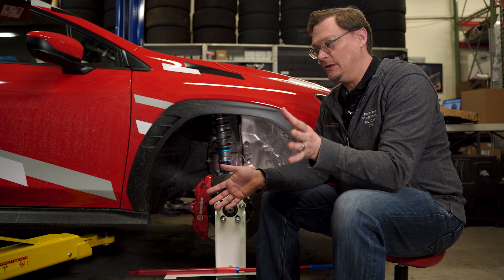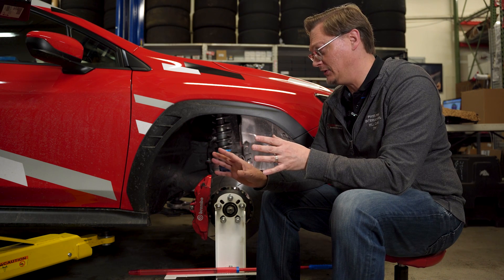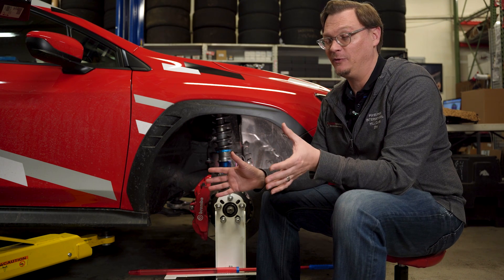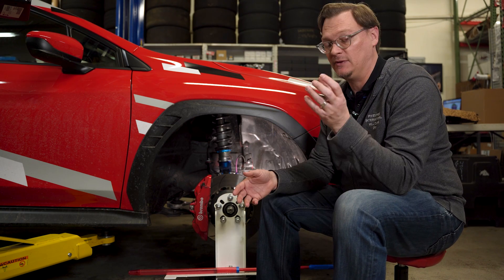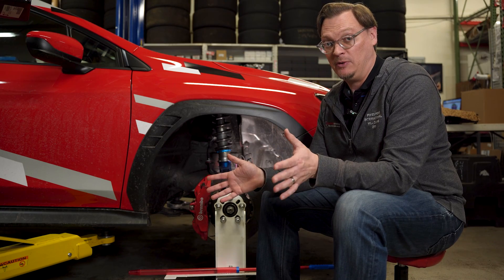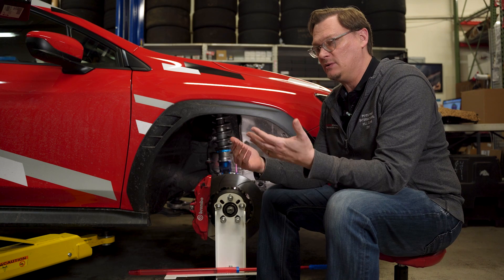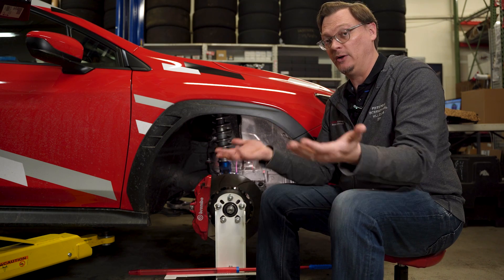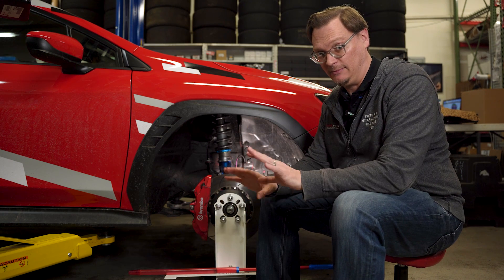There was a manufacturer that said not only were the coilovers set up from the factory, but they had corner balanced your car from the factory and all you had to do is bolt the suspension on and you were good to go. As great as that would be, it's not exactly fully correct and it gets a lot more complicated. You want to double-check when you get the suspension on: if it's a fixed or threaded strut, make sure you're starting with the same amount of threads on both sides and the same spring perch location on both sides. If you're getting different results left to right, figure out why and correct it before putting the car on the ground.